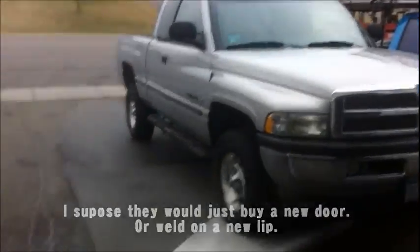I'm fixing a truck that is just going to get sold anyway to somebody that is going to get a good-looking truck with good bodywork. This might be how the high-end shops would do it. I have no idea. If you guys know, let me know. But for a void like this, would you fill that with seam sealer first and smooth the seam sealer down and then undercoat it? I don't know if undercoating can even go over seam sealer, or would you just undercoat straight on the bare metal and have all these voids? It doesn't make any sense to me.